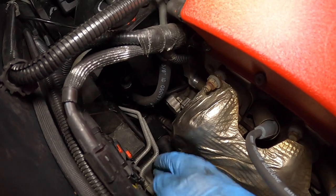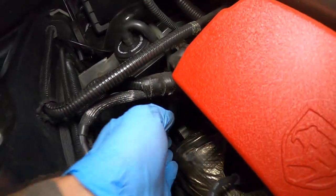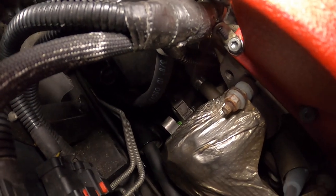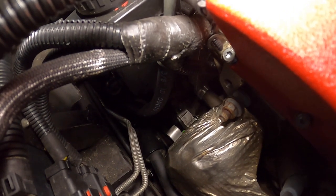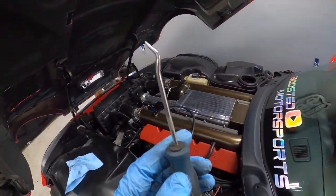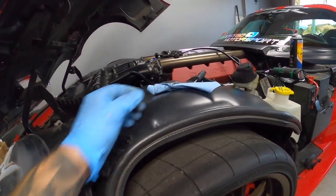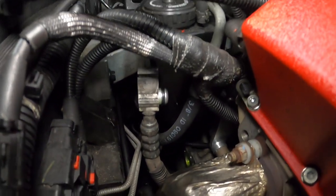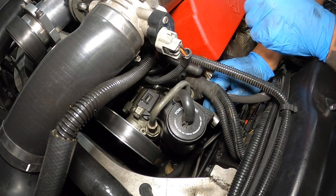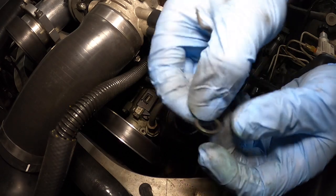We're going to take that 10mm bolt out, take this bottom hose out, and change that O-ring. The lower hose just easily pops out. You can actually see it looks like maybe somebody already replaced one of them — one O-ring is green and one is black, so maybe they only changed one. We're going to replace both. A little pick tool will make your life easier to get those O-rings off. If I had to guess, I think the top one is the one that was leaking on mine — it's not quite as flexible as the green one. This original one is all square and hard looking, so this is definitely the culprit. Looks like somebody changed the lower one already.